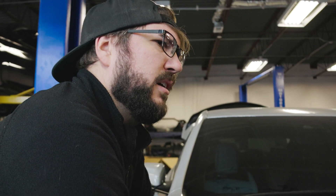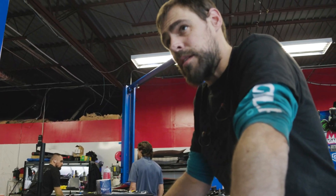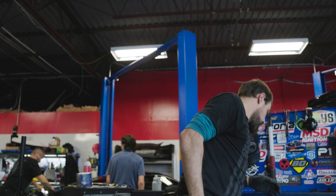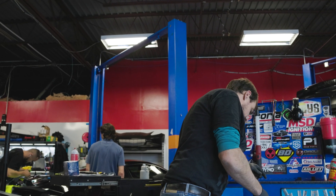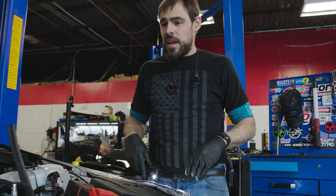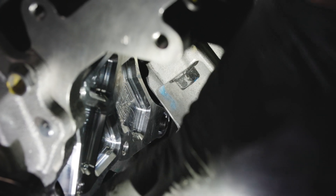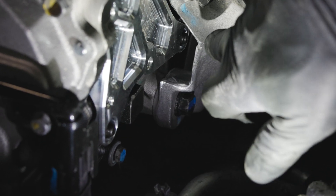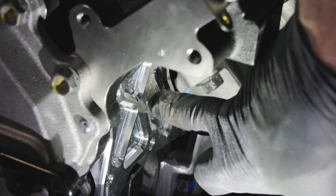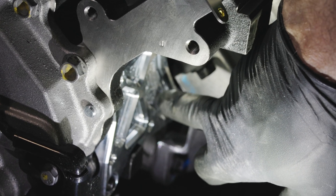What wasn't clearing — what's different now as far as dimensions? So the 6.6 liter does not have the side block accessory mount holes. So LME came out with an accessory bracket that bolts into the engine block in the spot where — at the main cap locations. Those are the studs into the sides of the main caps inside the engine block. This whole accessory bracket — I opened up that window right there so it could pass behind it.